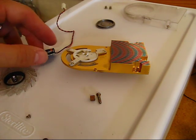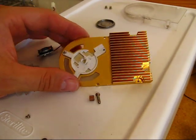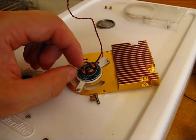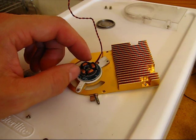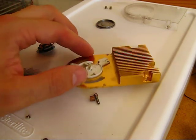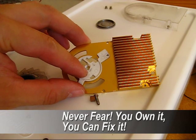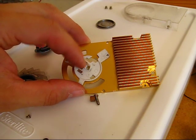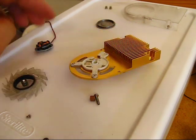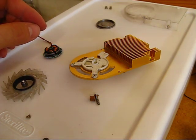Welcome to Bit of a Snag. I found a drill bit that was about the right size for the bearings, and I started to drill into the housing that holds the business part of the motor — and it kind of broke it off. A bit of a minor setback. I'm going to have to file this most of the way down, because it's bent sideways and I need to get it centered and small enough to fit the other bearings on the rotor.